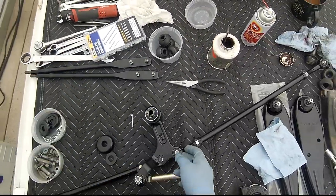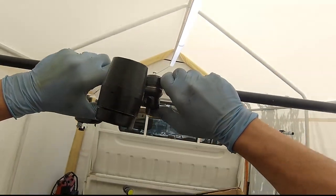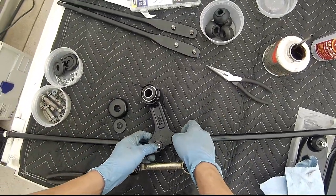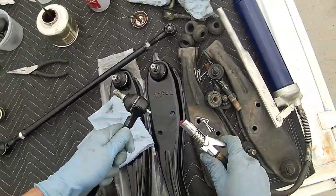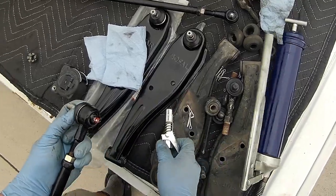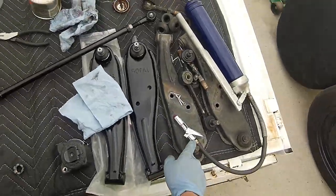So another issue you're gonna have if you have these ball joints with the Zerk fittings is that if you assemble this, it goes like this on the truck, you'll never be able to get to those fittings to fill this up with grease. What I'm going to do is pre-grease the inner ones first, maybe about 3 pumps. Some may squeeze out, which is a good thing. At least it's packed in there, because I don't think you'll be able to get to this unless you have a 90 degree fitting at the end of these.